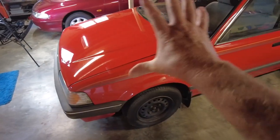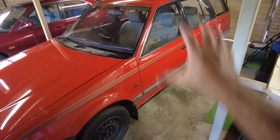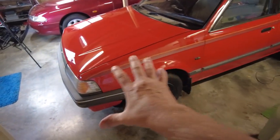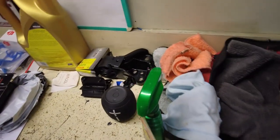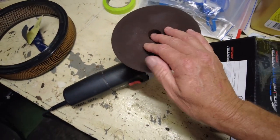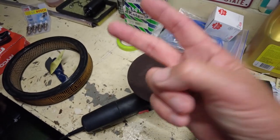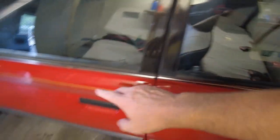Let's have a look at the car. We've done a major cut - the paint was all powdery and white. We spent many hours on it. There are a lot of intricate parts. It looked good when we pulled it outside, but on inspection under the garage light there were still cloudy patches in the grooves on parts of the bonnet. So I thought we're going to do better than this. Originally we used a hard cutting pad with cutting compound, but then I started using the polishing pad with cutting compound - two more hits over the body - then I used two different levels of polish: a medium polish and then a glass coat on top. So I've given another four hits over the car and the results are stunning.